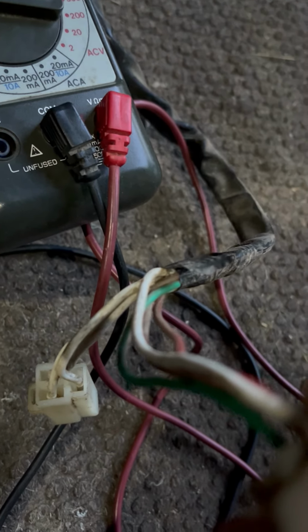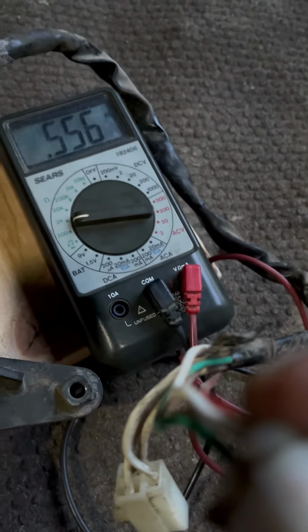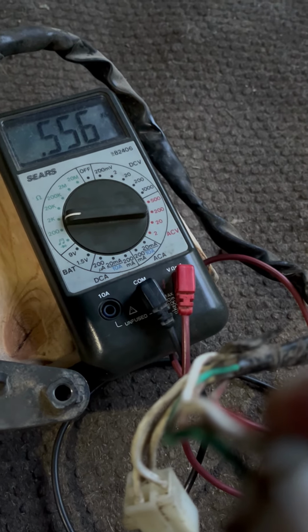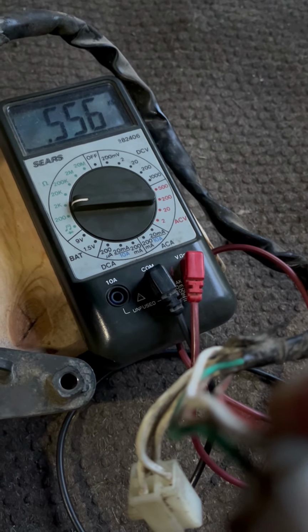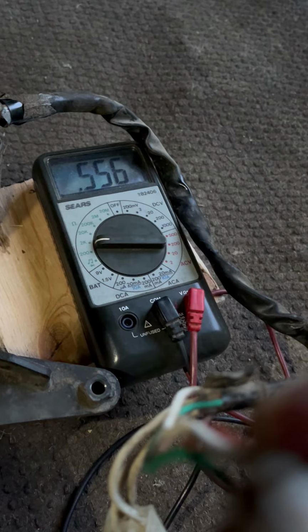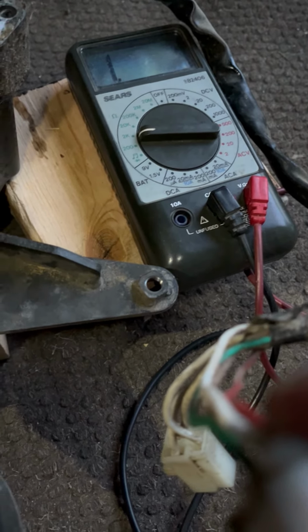And I'm trying to hit that. Hit it and quit it. All right, we're at 556. The parameters that it's supposed to be in for the green and brown wires, 270 to 330. So the coil here is shot. The pickup button for the first time is actually still good within spec. Okay, now